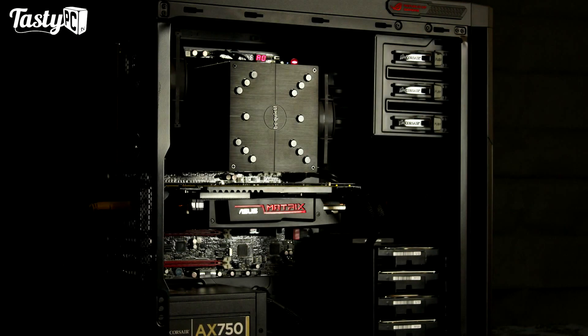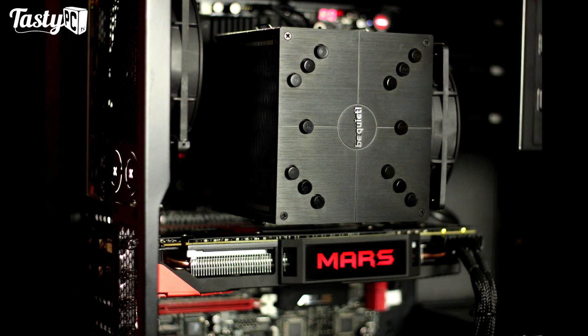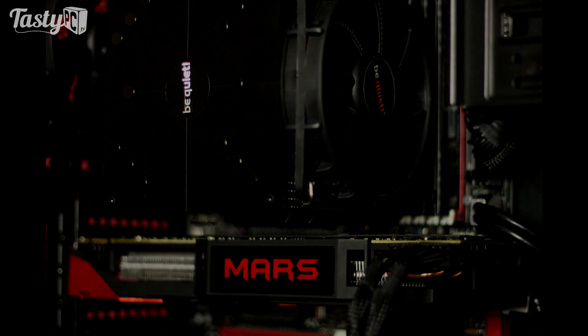After running all the benchmarks I moved all the cards to my temporary rig for noise tests, leaving all cards completely at stock just as they come out of the box. I unplugged my hard drive so it wouldn't make noise, but left all fans exactly the same as I use them normally, so a hotter GPU would cause the CPU cooler to run louder and increase overall system noise. While you're not hearing individual card volumes in isolation, you are hearing them in a more real-world environment — more like what it would actually sound like if you were using the cards yourself. Starting with the Nvidia cards...